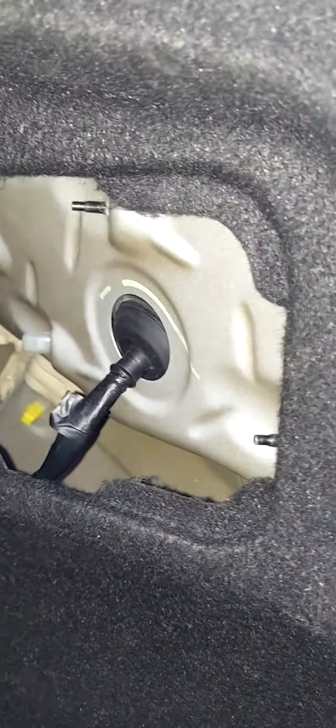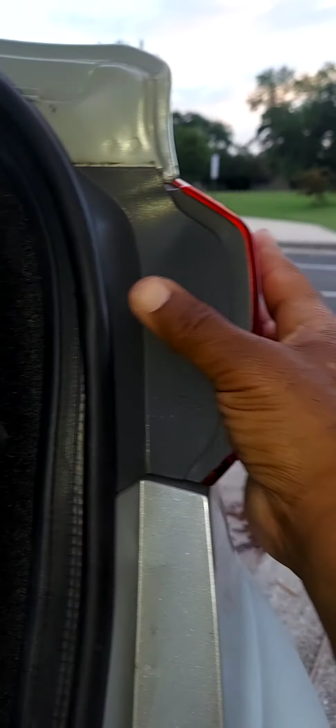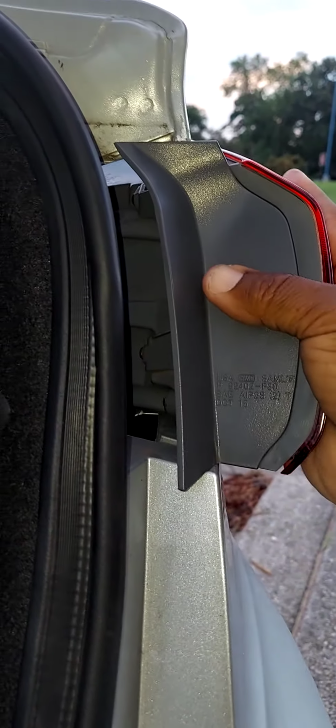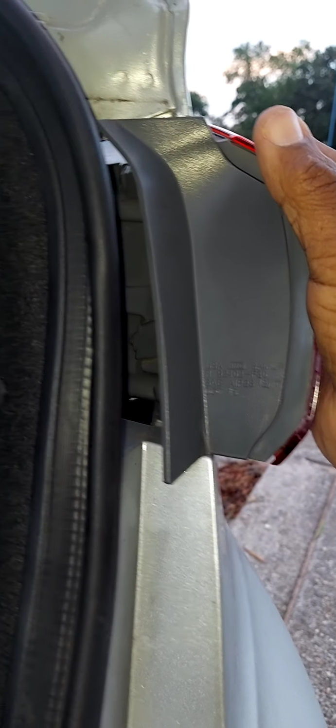And then what I do next is I like to push on these two bolt holders and try and force the taillight assembly out. Or you can just take both hands and go to the rear, and you just kind of have to work with it, guys, until it comes free. Be mindful not to drop this. And when you pull the taillight assembly away, you want to make sure that the electrical connector comes all the way through and does not get damaged.